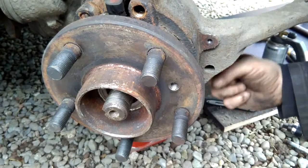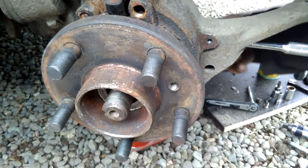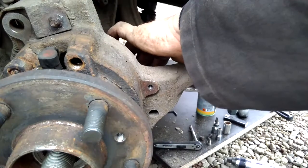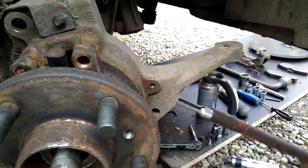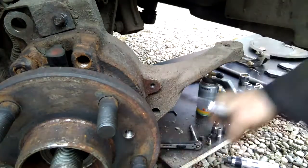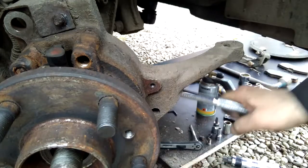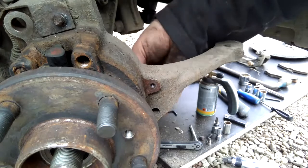which has been easier said than done, but always make sure that you've got all the rubbish off the bolt head, and it's absolutely sat on there, because you don't want these things rounding off, otherwise you're into nightmare situations. So using the socket and an extension, this should go as well. And there we go, nice and steady. Okay. I should imagine there's been loads of occasions where these bolts have been rounded off and you're just into lots of unnecessary work then, so just being careful and thinking about every single step, every twist of the socket set. And you should be okay.